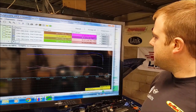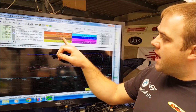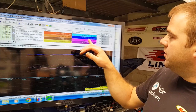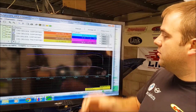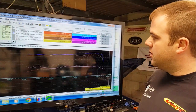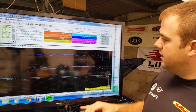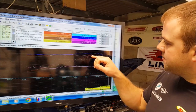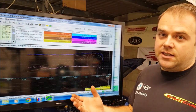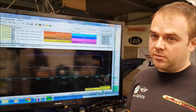After, we now have 169.8 horsepower there, virtually 170 horsepower, and 113.95 foot-pounds of torque, virtually 114 foot-pounds of torque. So again, that's a good result. And what we find here is pretty much what I expected to find, is that you get more of a gain higher up in the RPM range. Again, this is down to airflow. It's simple physics. The quicker you can get air in and out of the engine, the better it'll be, the more power it'll make, and so on.